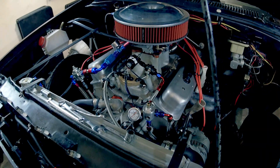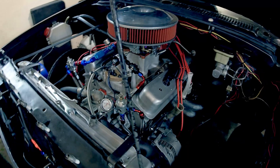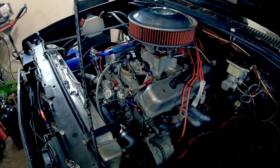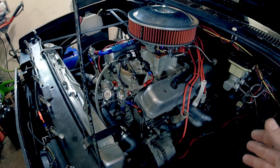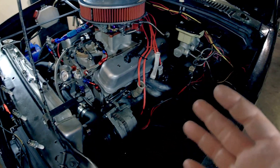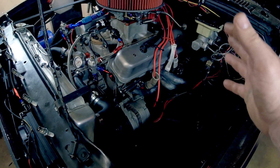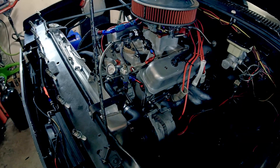How to read your plugs ideally when you're spraying nitrous: you want to use your old plugs, let it warm up, then put fresh plugs in. I didn't do that for this video because normally I drive to the track, put fresh plugs in, go to the line, hit it, shut it down, and pull them all and look at them. But the track's closed, so I'm just going to be driving five minutes, making a hit, then shutting it down.